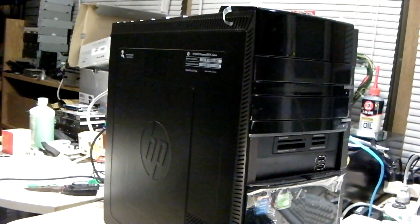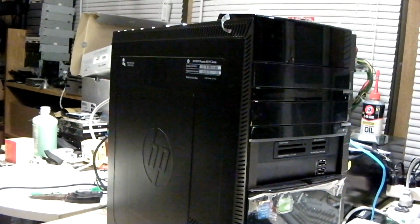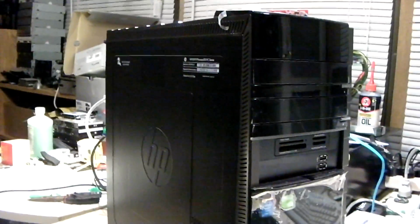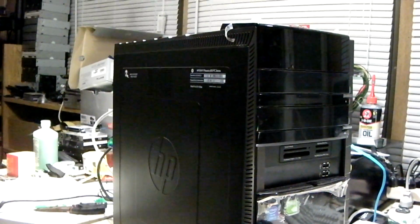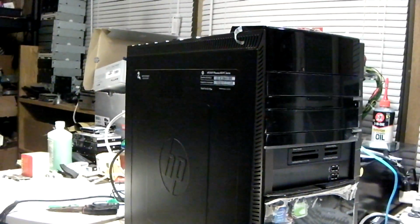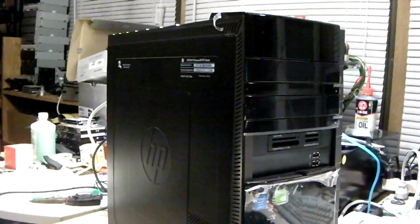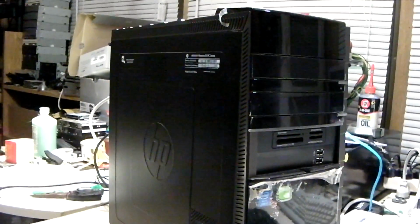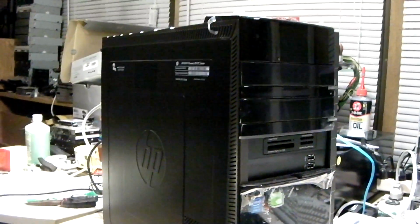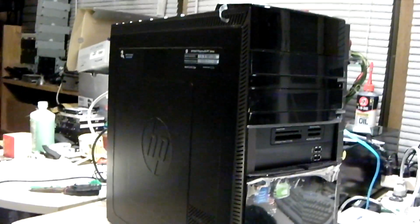And it's not HP's fault here. It's actually the hard drive, and of course, it's a Seagate. It wasn't too much of a hard guess, I'd imagine. It is a Seagate ST2000DM001. I had two ST2000DM003s, two ST1000DM003s, 1 terabyte drives, and I think an ST2000DM001. Every single disk failed. Two of them failed within the warranty period, and the other failed outside of warranty. The STX000DMXXX drives are garbage. They're garbage. I've seen so many of them fail, it ain't funny.